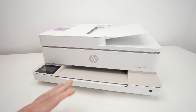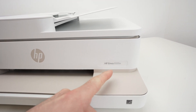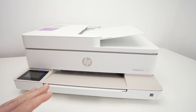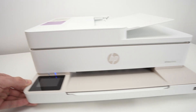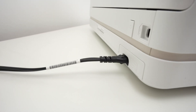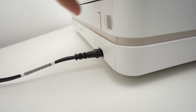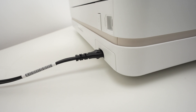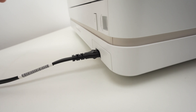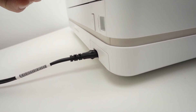In this video I'll show you how to fix issues with your HP Envy 6555E or similar models. The first thing you need to try is to go on the back of the printer where the power cable is located. Pull this cable out even if the printer is turned on, wait five minutes, and then plug it back. This is just a soft reboot — it will not delete anything, and most problems will disappear after you do this.